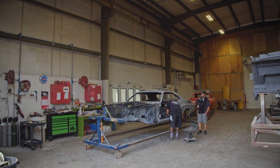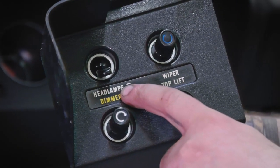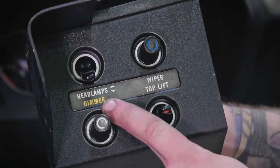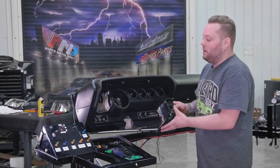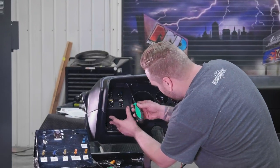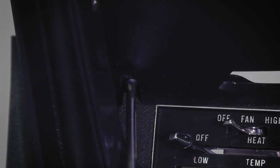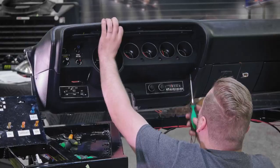Now we can put our control panel right in here — it's all in one piece. In the case of this car, you have your headlights, your wipers, your dimmer switch, and we got the convertible top, so you got your up and down switch. We did the dash ourselves — the instrumentation, the switch panel, we reconditioned everything. We put a new underdash wiring harness in it, the heater box unit, all correct stampings, an overhaul kit with new gaskets and foams, new heater core. I had Mike out of Instrument Specialty send me the Black Jewel suede dash paint in the original nitrocellulose lacquer with the suede on it — that looked really perfect too. It's a very nice looking OEM dash going in that car.